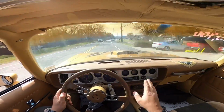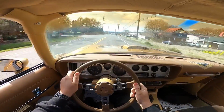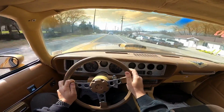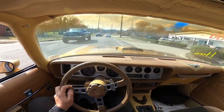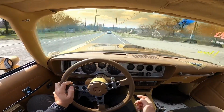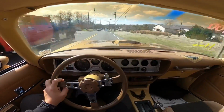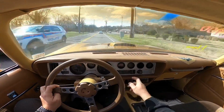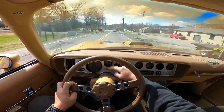The car still has that right pull. It also still has a little bit of shake to the steering wheel, like it may be in the tire. Water temperature is working and is in a great range. Oil pressure is working, speedometer's working, and the volts are working. Gas gauge is out on this one, and the tach is out on this one.